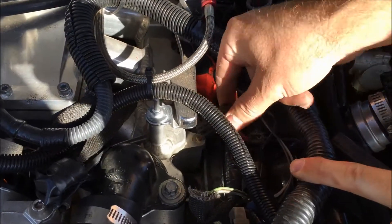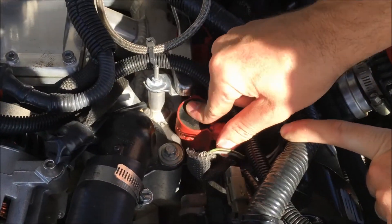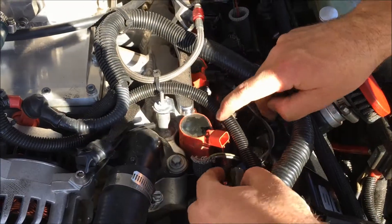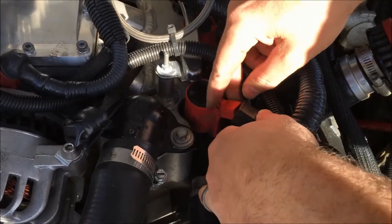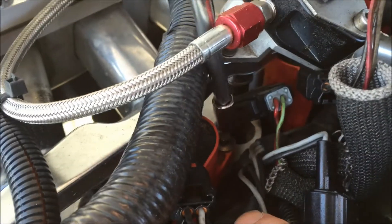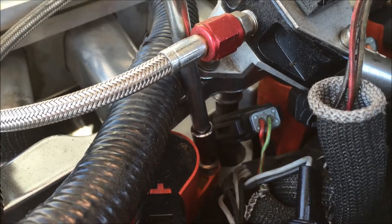Put your fuel injector clip back on, then your ignition coil goes back down in. As long as you pull up on it and it has a firm suction, it's good. Find your ignition coil plug and plug it back in. Now you can move to the next one. When removing these ignition coils, some do have the little bolt that holds it in place — just a seven millimeter bolt — so you'll want to take that off so you can pull the ignition coil off.